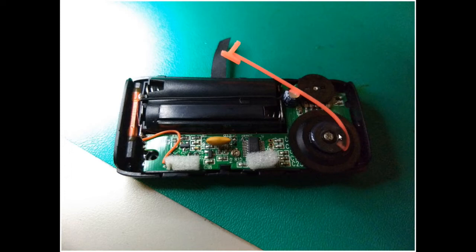This is what it looks like with the back off. This red piece of plastic is your tuning indicator. If you're wondering how to get it back together — when you open it, it just pops out — keep the red part fully extended. The main part of the red plastic rests right on the ridge of the battery holder closest to the circuit board. The tip sits in between the two batteries. You'll want it all the way at the bottom position when reassembling.